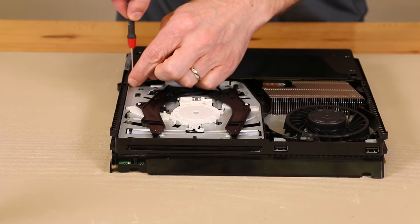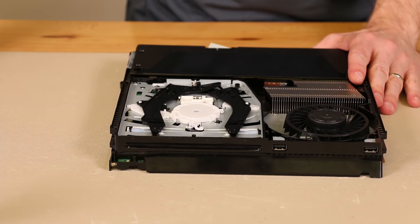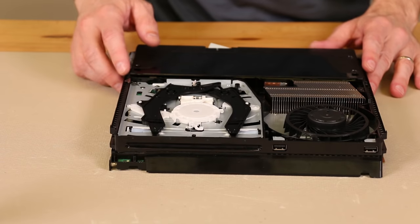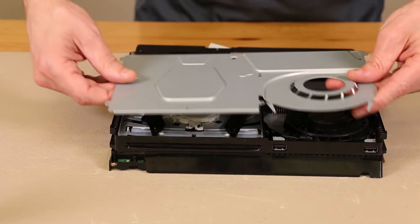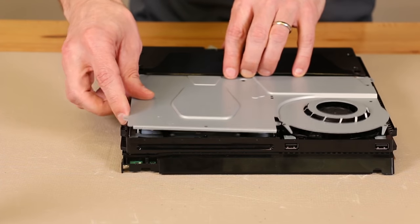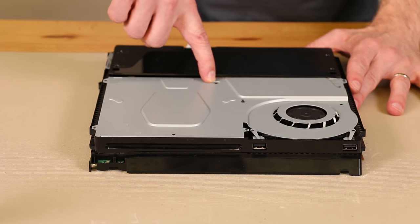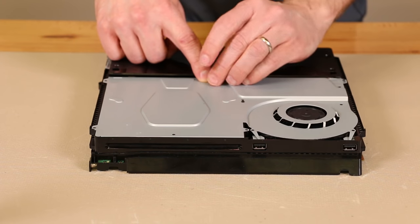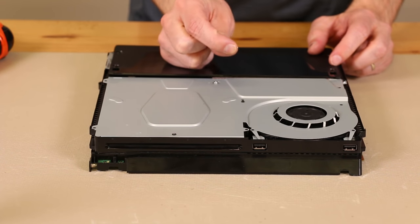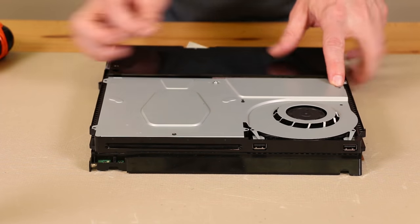So there's that plate and the two screws are installed. Now, before we put the metal plate on the top, we need to make sure and install this small metal piece right on the edge right here. Like that — there's a little groove it goes into. And then this metal plate goes on. So we're going to lift up on the back of the power supply and get the metal plate slid into position right there. Now we need to install all 10 screws on here. Remember the black screw goes here, and the long T8 or T9 security torx goes here. We'll install those screws first. When you put it back together, you do need to also note that there's one screw that has threads that are closer together — it's called a machine screw — and it goes down into metal on this hole right here.